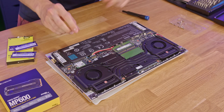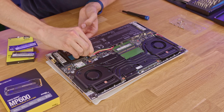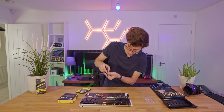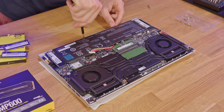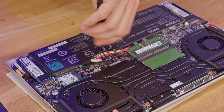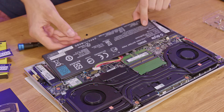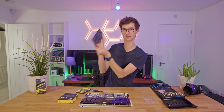The first thing I would always do is to remove the battery — it's just a little bit safer. Don't grab it by the cable; just remove this little plastic component and then the whole thing should unplug. If you do want to replace the battery, just unscrew it from its holder — a total of three screws. Again there's a warranty black marker on it to try to get you to not remove it unless you really need to. But then that is it — it just removes, you just pick it up. You'd buy a new one and just pop it in. Really straightforward.